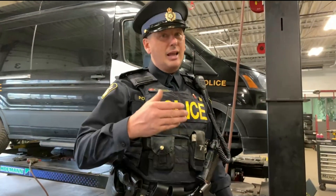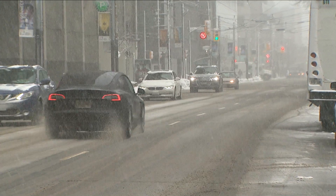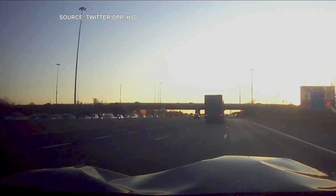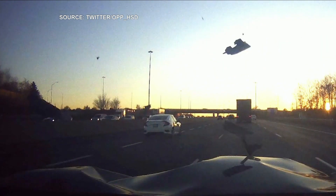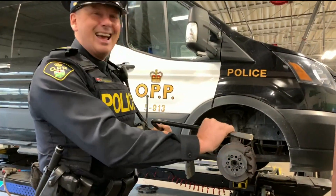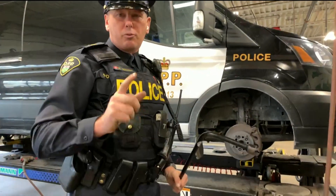This is also the time of year when we see a spike in wheel separations — tires come flying off vehicles. It's equally deadly with a passenger vehicle or a commercial vehicle. You've got to make sure those wheels are properly installed. Once you put them on, drive a short distance, then go back to your tire shop or check your manufacturer's instructions. My truck needs 150 foot-pounds of force — at the end of one foot of lever, I need to put my body weight into the torque wrench to make sure those wheels are properly secured.